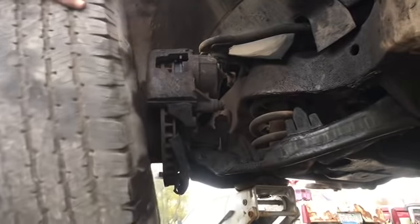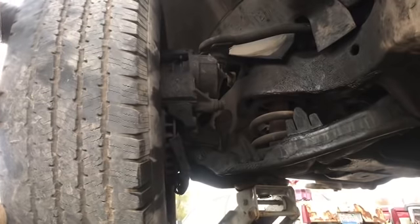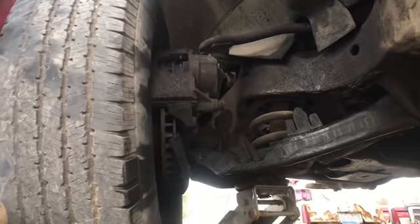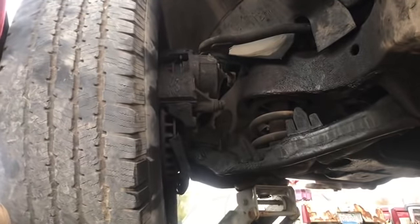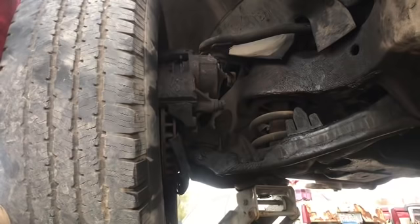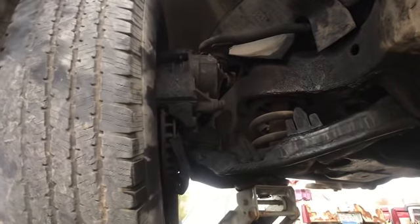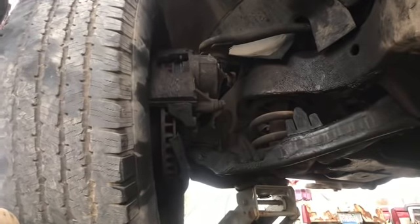That pad is going to wear out really quickly. Actually, the last one was scraping also, so the rotor's already been ruined. I got about 5,000 miles out of that. Oh, you're supposed to get about 20. No. The way I drive, first of all, those are the cheapo ones, the $11 ones. And scraping, there's so much stop and go. Even with new rotors and new pads, the most I can expect is about 15,000 miles out of a set of pads, because I'm constantly stopping.